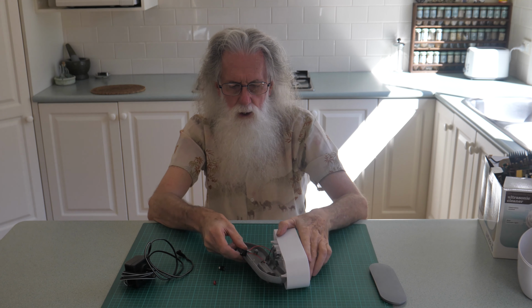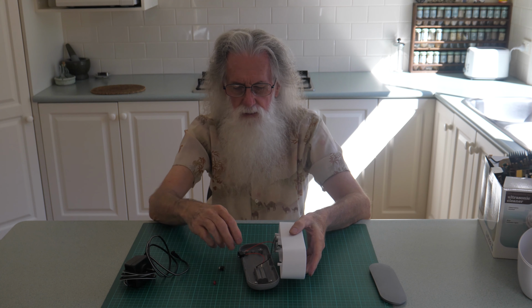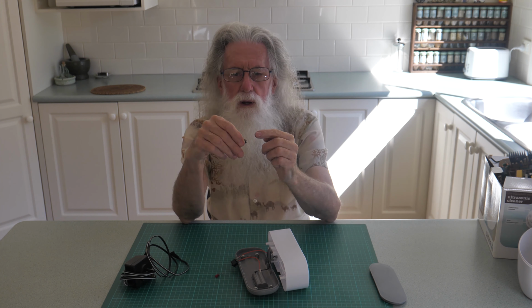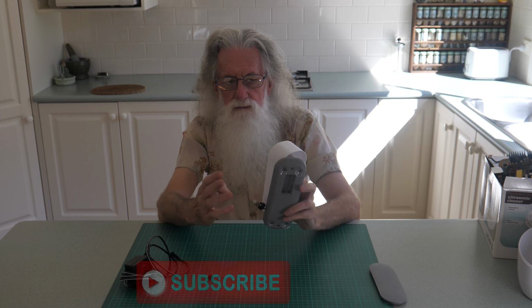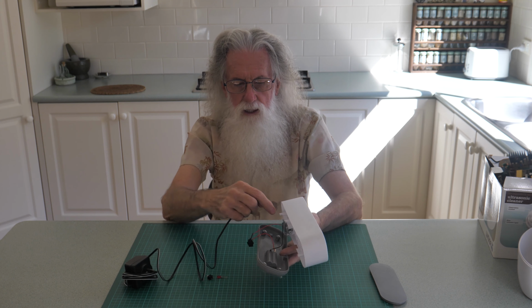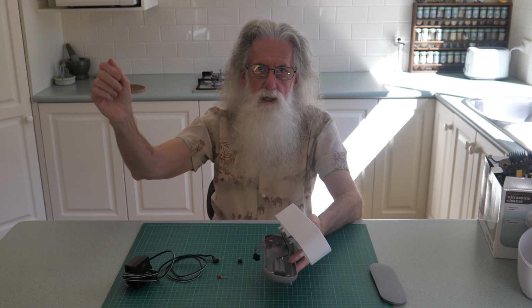Why is that important? Well, you may have your AA batteries in there and you plug in your power supply and you can't charge alkaline batteries and all that. So that's a safety thing. I've crimped on a couple of terminals on there. There's no LED to tell it's on. So I'll drill a hole, solder wires from there to there, get the resistor with the LED, and then when it's on, use the switch, and then if you push the pin in, it will disconnect that lead. I have to jump it across, and then you can use your power supply. The only switch would be on the wall.